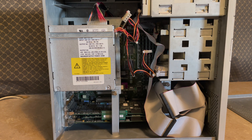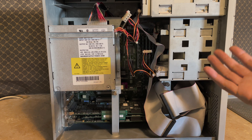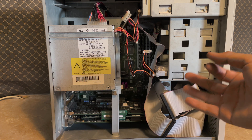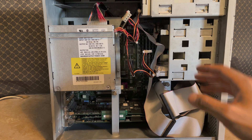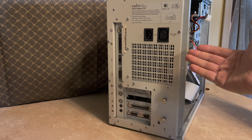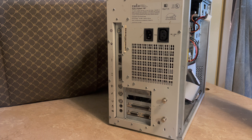We're also going to see what this computer's got inside it already and what we're not going to have to buy. The special thing about this computer — and I'm sure this is true of most older Macs — is that you probably want a CRT to view this, but in my case I don't have a CRT. A regular VGA LCD is just not going to work because you actually need a sync-on-green capable display. Not all displays are sync-on-green capable, and if you try to use a non-sync-on-green display, it won't blow up — you'll just get a very strange tint. I have a sync-on-green capable HP flat screen monitor that we're going to use with this.